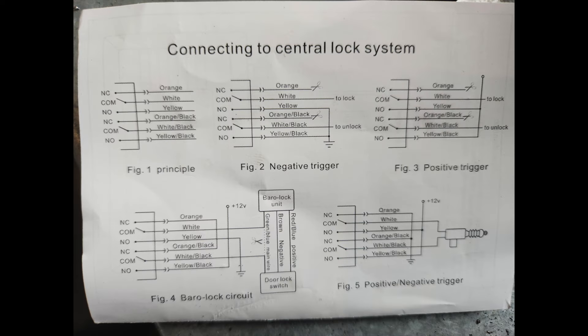Now that it's wired up correctly, since these units have so many wiring options we don't need all the extra wiring. MMWA has tidied that up and made it a lot neater. He's used a harness from an old Mercedes wiring harness I had to get a loop terminal connector to put onto the fuse block. This could be tapped onto a permanent source under the dash like your clock, but we've decided to connect it to the fuse block at fuse number 2, which is a much neater way of doing it. You can see the old harness going onto the loop terminal, making it much easier to screw on neatly.